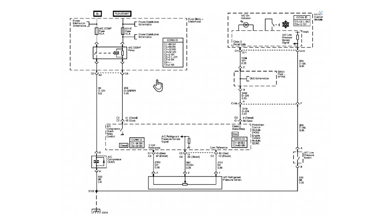In lieu of running the engine and allowing the PCM to drive the AC compressor clutch relay, I'm going to be back-probing this circuit and supplying a fused path to ground to take the place of the PCM. We have to consider the limitations of this test — by doing that, I am eliminating the PCM, so if the PCM was the issue, I'd be bypassing it and would not see the fault. Keeping that in mind, when I provide that ground path, just like if the PCM provided it, current should flow through the relay coil creating a magnetic field, and that magnetic field should create physical shuttling, allowing the switch to close, which would provide the current flow necessary for the AC compressor clutch coil to function.